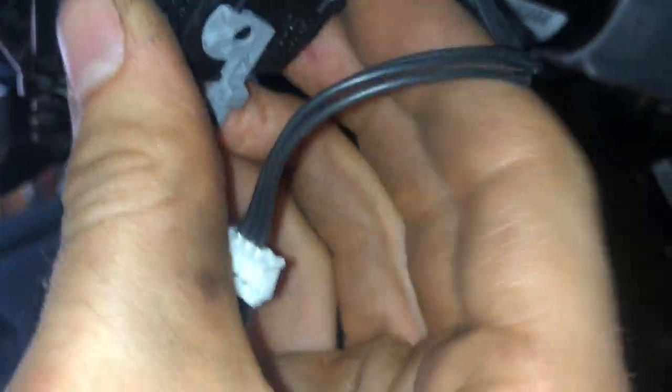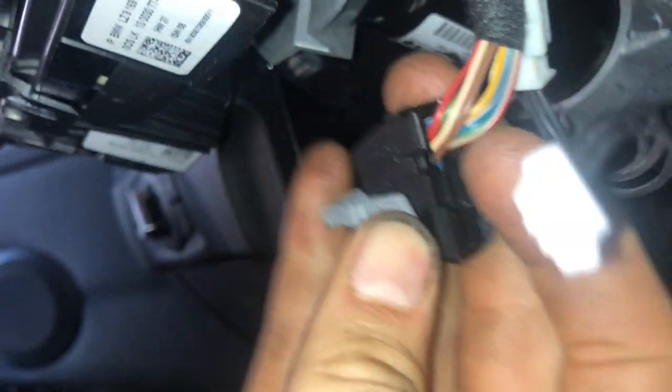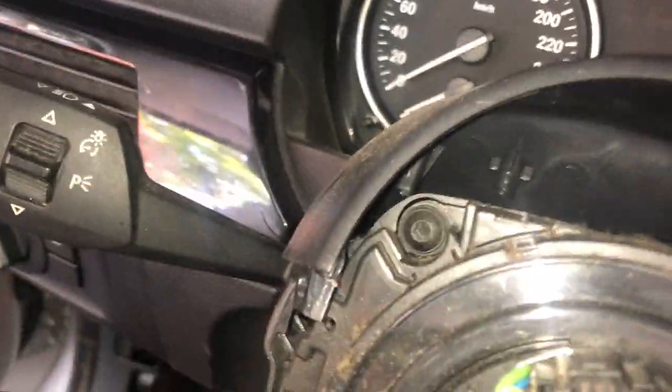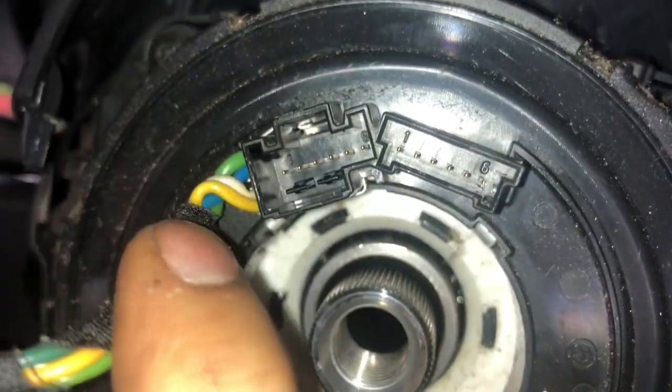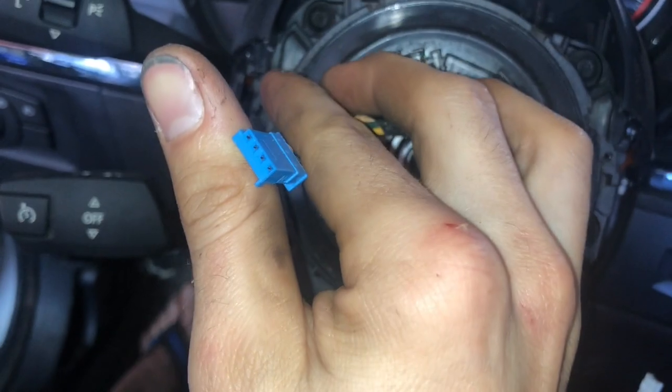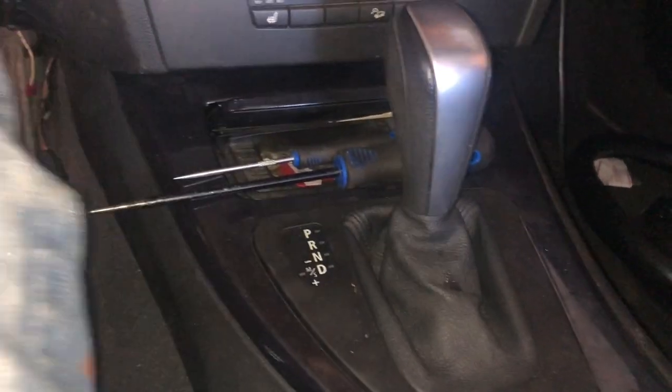For the steering wheel retrofit, the harness — you have to splice into this connector right here. I'm going to take this out and have a closer look. Some people build an extension harness; I'm not really wanting to do that. Two of these wires are the outputs from pins four and six, which go into here. This is the connector for the heated steering wheel — be careful when removing that so you don't damage it. We're also going to run a wire that goes from here back to the console to the shifter. We're going to pull all this apart and look over the wiring guides.